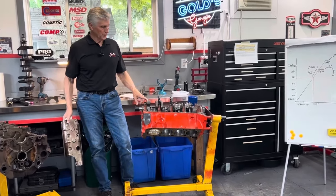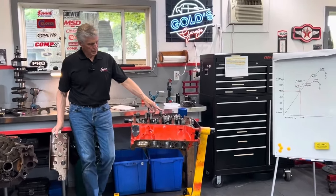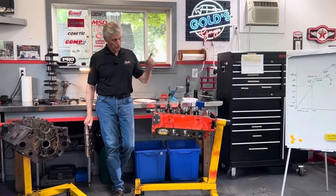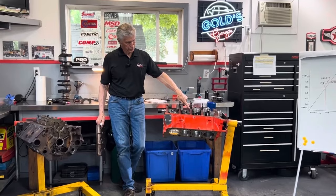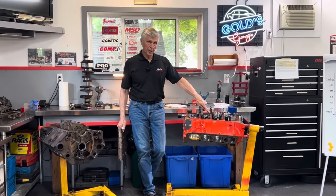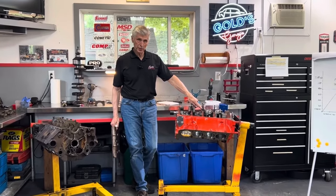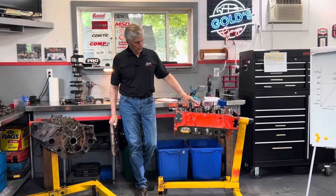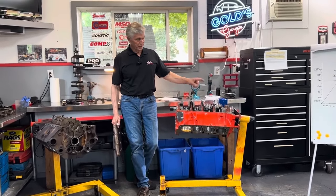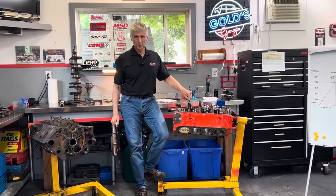The stud kit Tony bought — it's the only one available from ARP — the studs are too long, just like the bolts were too long. So I had to use three hardened ARP washers in order to get enough thread engagement to torque it properly. Unfortunately, I have partial ARP bolt kits sitting around. ARP makes a beautiful product — it does everything they say it can do, and the manufacturing process is second to none. That is not a problem.